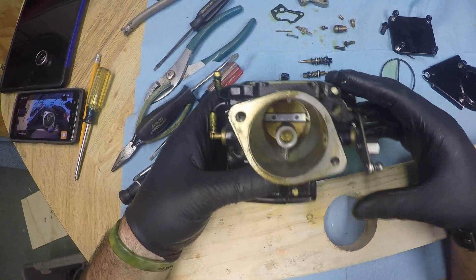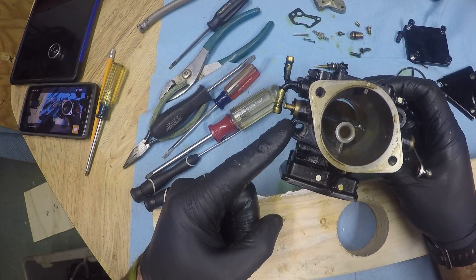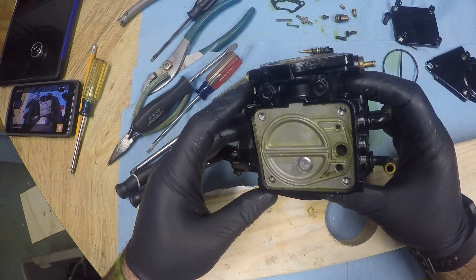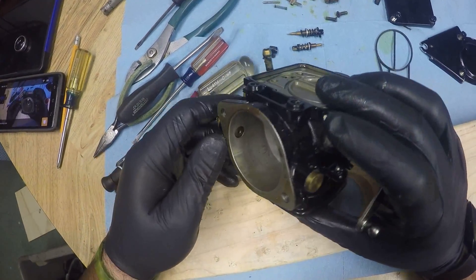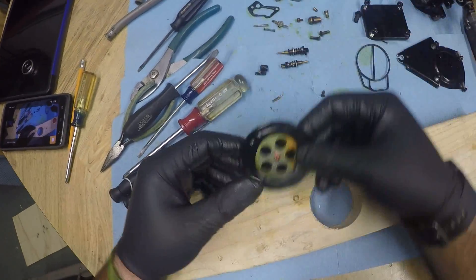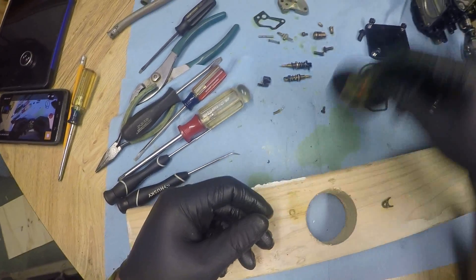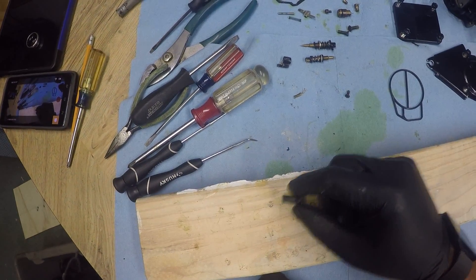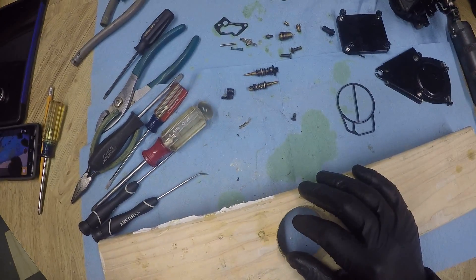And that's going to be about it for disassembly. You'll notice this carburetor does not have a choke plate — it does have a primer setup. The primer inlet you can see highlighted right there and the block-off plug there, but that is normally where the choke plate is installed. Primers allow it to start a little bit easier without having to crank so much — you can prime by squirting a little bit of fuel right into the carburetor without it having to try and draw from vacuum alone. I hope this has been informative. We're just going to check out a couple more parts here — diaphragms, gaskets, and whatnot — just to show you the condition this carb came in. In part two we'll probably do a reassembly and rebuilding, but the disassembly — the hard part, I think — is all done. Thanks for watching.